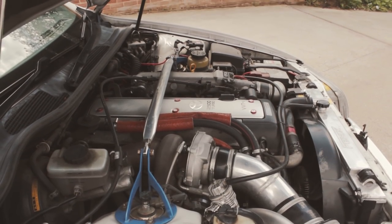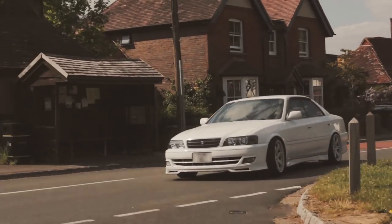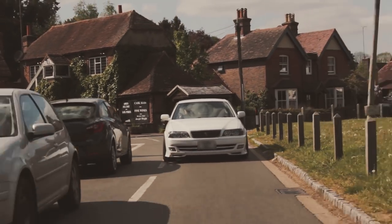How are your engine temps? Do you suffer when doing skids or hard driving? Mine doesn't really go over 100°C. Mine gets up to about 110°C when doing skids. What about oil temps — do you get bad oil temperatures? Yeah, around 110°C. What oil are you running? Fuchs 10W-50. From the factory they came with something like 5W-40, but with the horsepower you're running it's better to have something with a bit more viscosity.